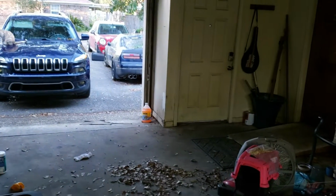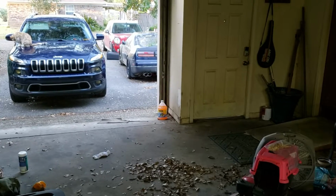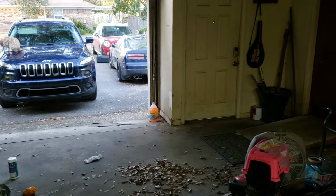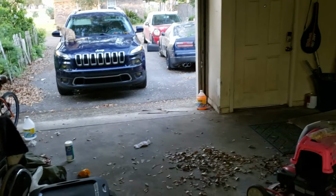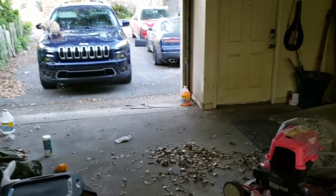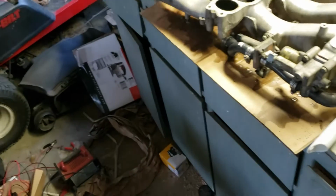I mean, I've got 250-plus thousand miles on this motor, and it's still going strong. The last time I dynoed it, it was fine. I've checked the compression. The compression is sound. I was getting 180 on almost every cylinder, solid. It was just, what the hell? This engine should be dead. This engine was abused. Why is it still running, type thing? So that's plans down the future.